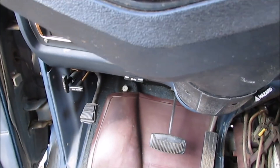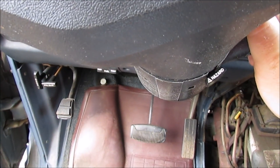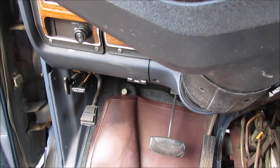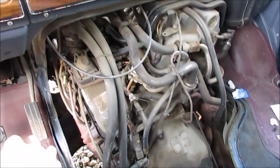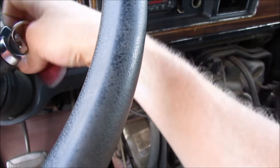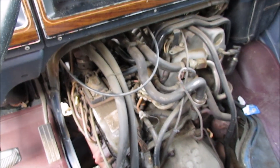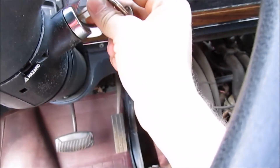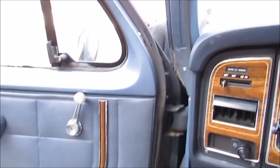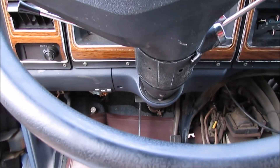Let's flip it back to the front — is that fuel pressure? Yeah. Want me to start it? It's only got 10 pounds — start it up, let's see what happens. Okay, let it sit for a second. It's at 28 pounds and dropping. We'll let it sit for a couple minutes. One thing we need to do is come back and put an AC compressor on. Well, that'll end this one here guys — I just wanted to show you the fuel filter.